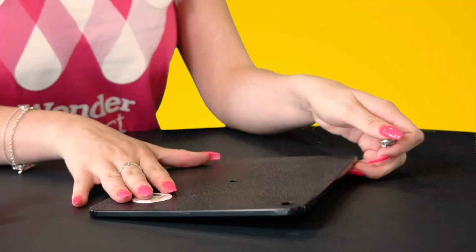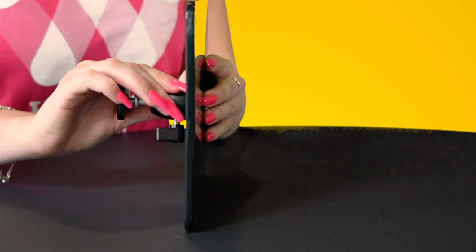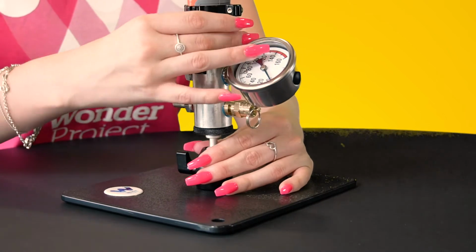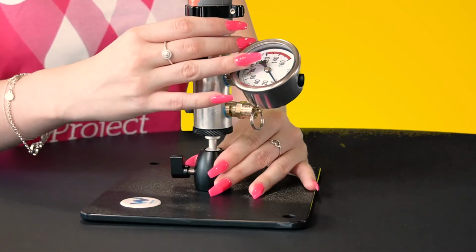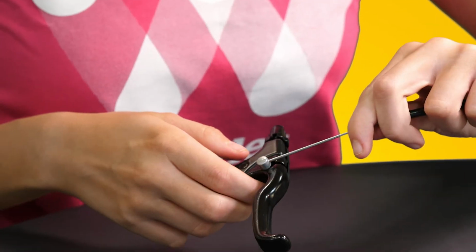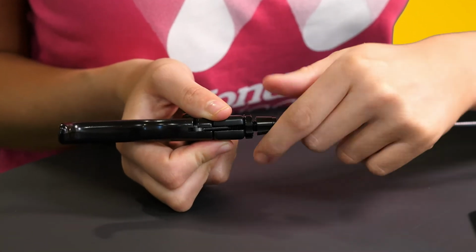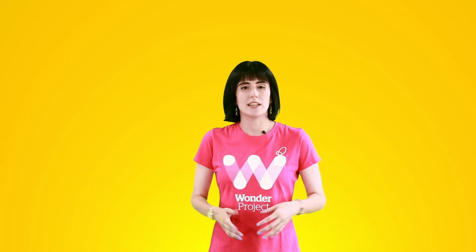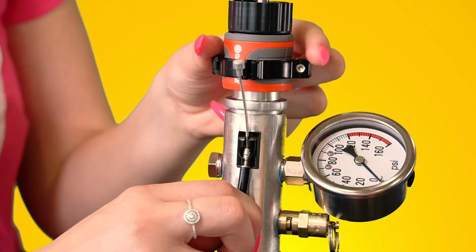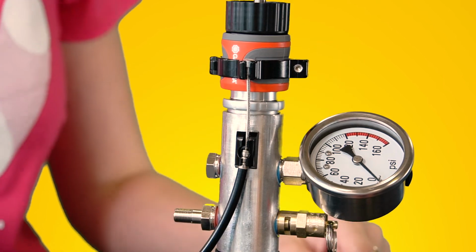Step 4. Now put your launcher onto the plastic base with the stainless steel Phillips screw. Stretch out the brake cable and place the fat barrel part into the brake lever slot. Then secure it with the slack adjustment ring. Insert the other end of the cable into the manifold cable stop and push the hose connector down. Then place the end of it into the black cable stop.